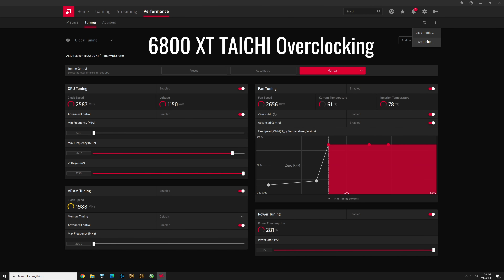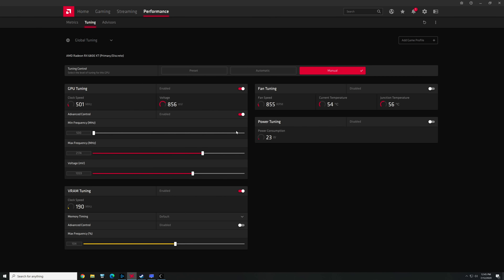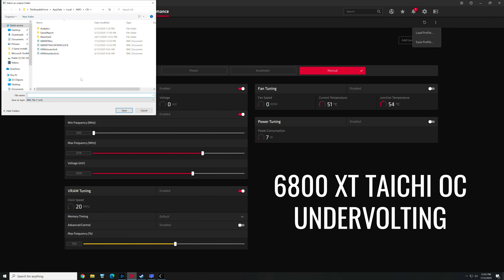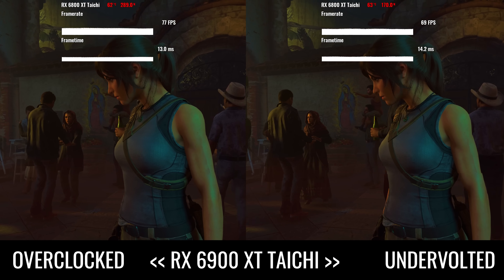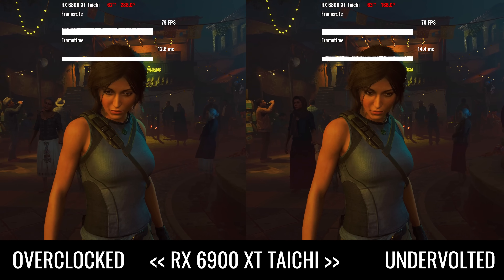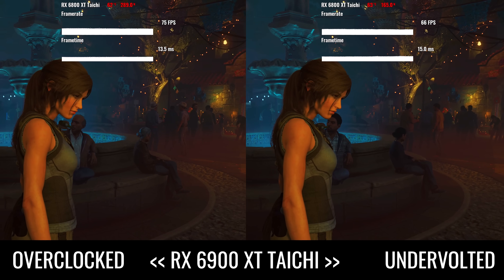On the flip side — undervolting. A lot of you are interested in undervolting these new cards, and here's where we saw a phenomenal drop in wattage. When we dropped it down to 1060mV and reduced clocks to roughly 2.2 GHz, we saw wattage drop by over 100 watts. So this card will undervolt very well. However, performance will dip since this is a factory overclocked model. Whether saving 100 watts and keeping the card cooler and quieter is the right choice is up to you — I will be putting my Radeon profiles in the description if you want to load them up. Do keep in mind I'm running in a hotter ambient climate, so these profiles should work on the majority of people's PCs.